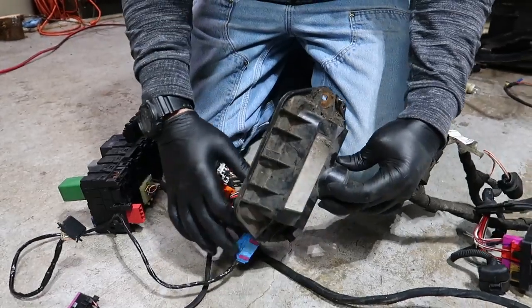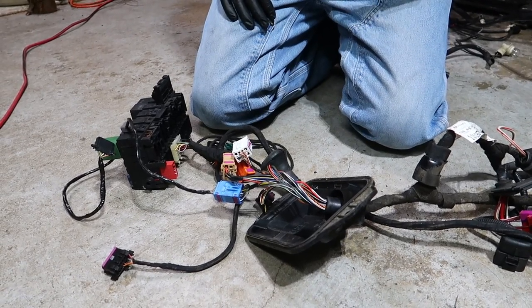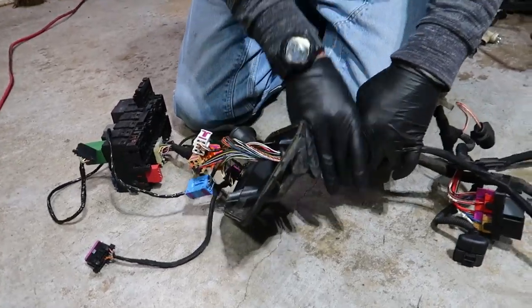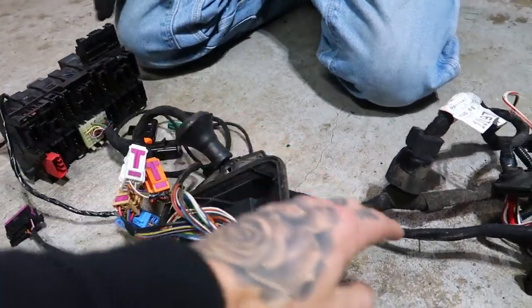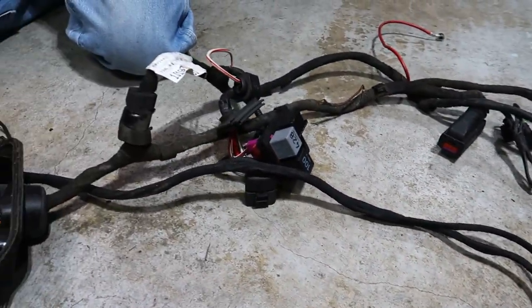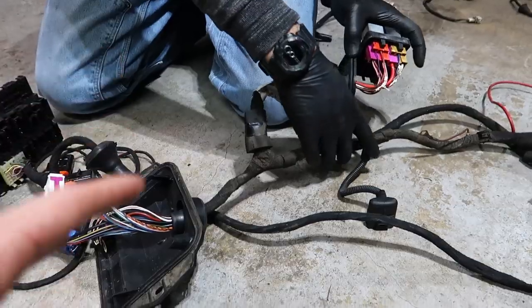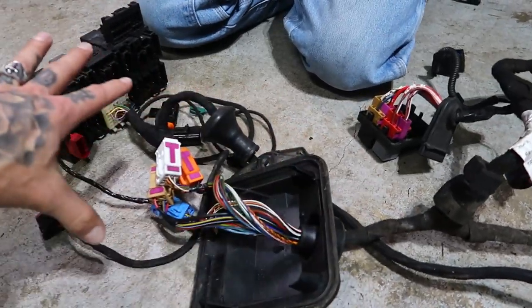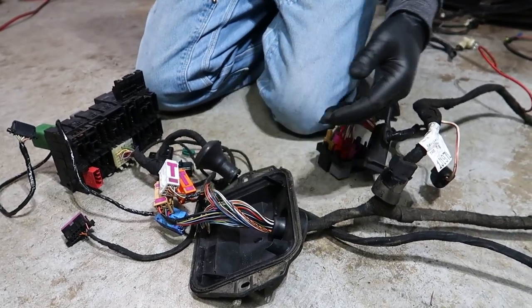So obviously this would come off, and kind of lay things in. I like to lay things in and see how it looks clean, and then take electrical tape and wrap in joints where I want it to go. So this is all inside the car. This part of the harness, you're gonna push through, and this is the only thing from the harness you'll have out here. I know this is probably rough, trying to visualize all this, but we'll do it again when we're actually putting it in. From this point on, this is all in the engine bay, or on the engine. From this point in here, this is all inside the car. And you can usually tell where what needs to be inside the car because the wires are protected going outward.